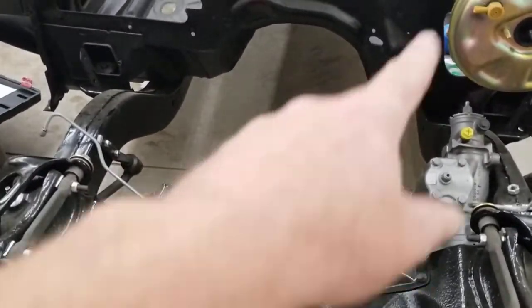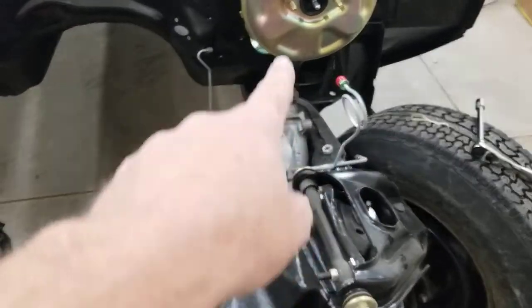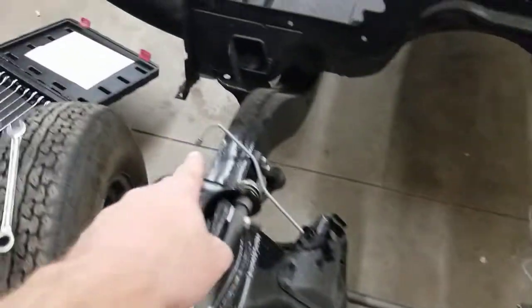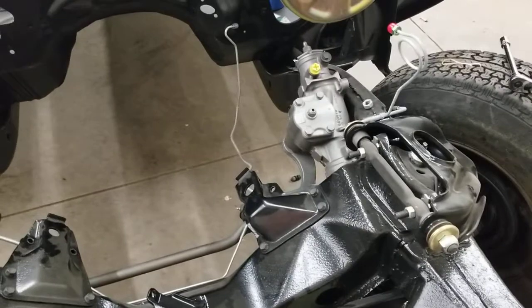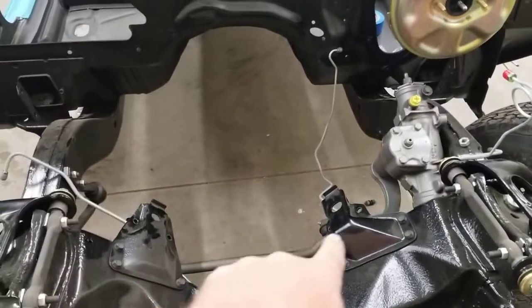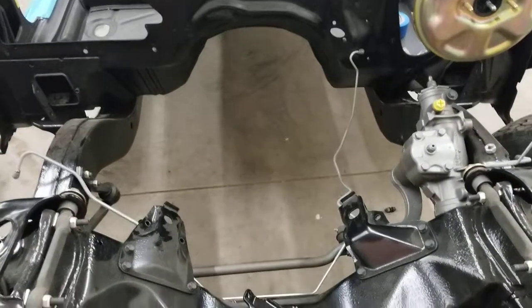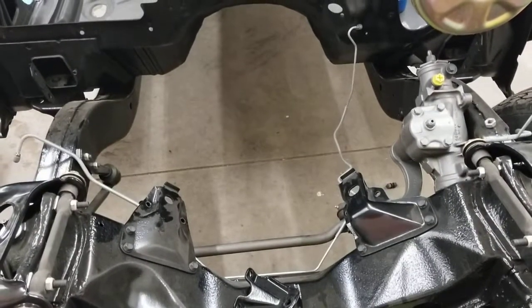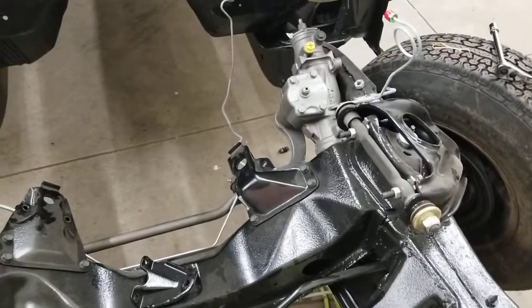And the really fun thing is the '71. That right side, it couldn't be the left side, that's really short. No, it had to be the right side. The flare on the end of the line is no good. It leaks out all its fluid. Pukes it. So that's going to be fun on that '71, because that means exhaust has got to come out. Motor's got to be picked up. Son of a bitch. Anyways, we're going to do a little update. What a train wreck. Later.